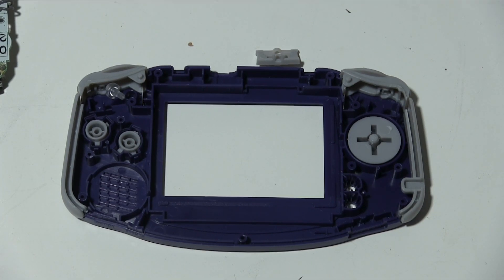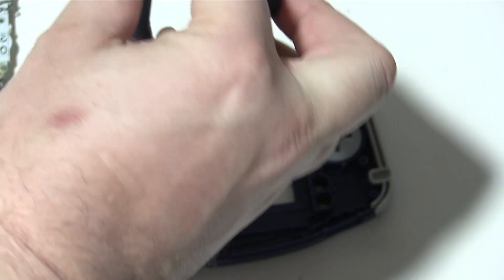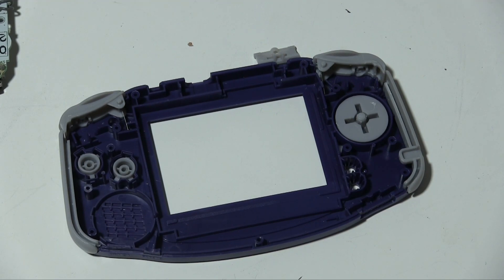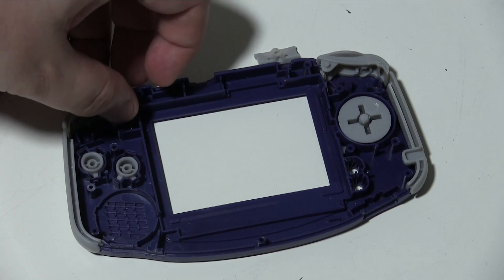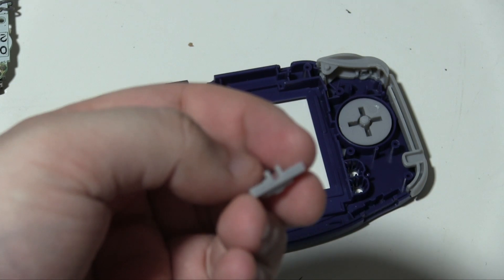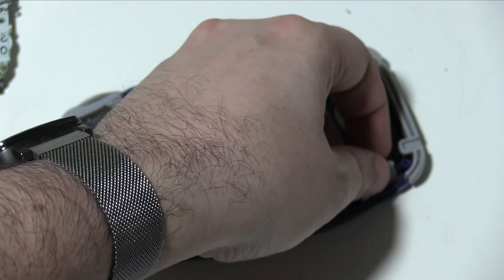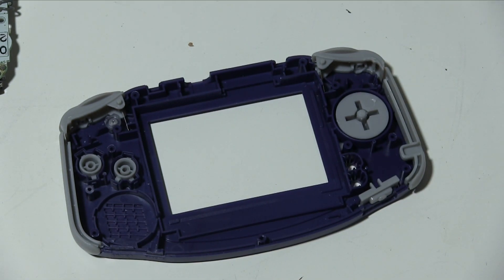My fat fingers can't quite reach it, so I'm going to use some needle nose pliers. I'm also sitting quite a way back from the actual thing so I can get the camera in, so I'm not quite this inept normally. That will go in there. Then the power switch — these two things go around the actual switch on the motherboard, so they have to be upwards, and that will just slide in there. We have to make sure the switch is the same side as the motherboard one, otherwise it won't go in properly.